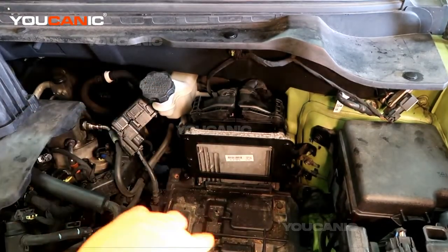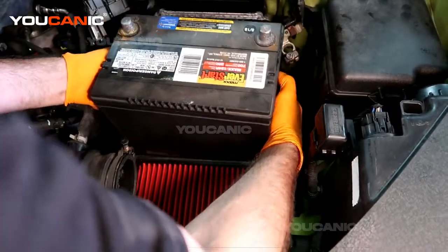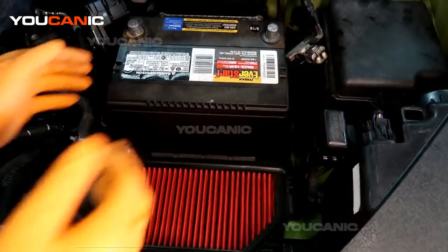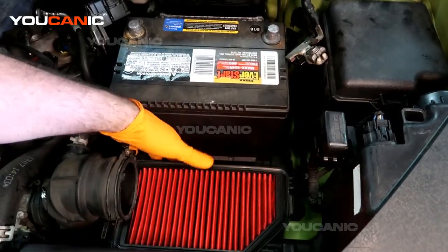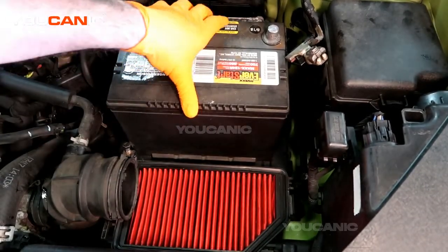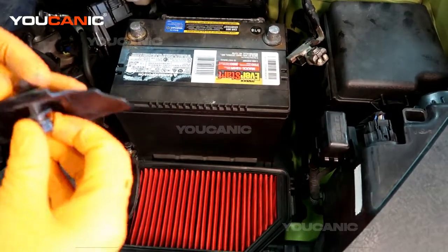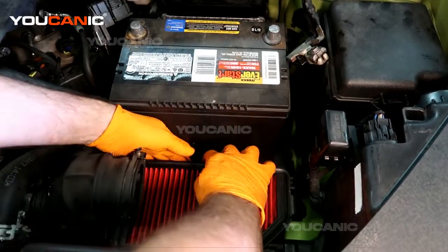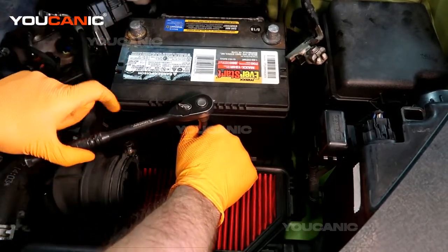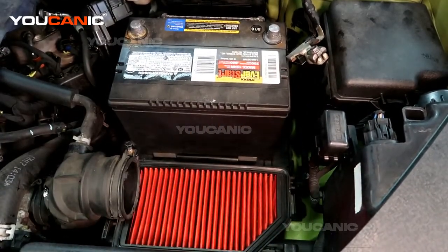And then you would just go ahead and put your battery back in, hook everything back up, take a replacement battery, and we drop it in, we push it back. There's a lip on the back side as well as the lip on the front side, and we've pressed it back in there, and so that locks the back of the battery in. Then we can put the clamp in on the front. Alright, that's tight, so now the battery doesn't move anyway.